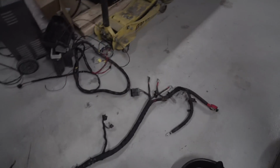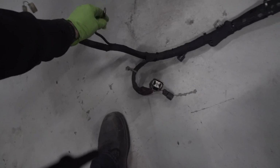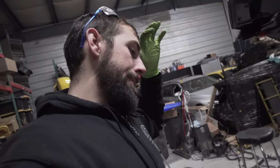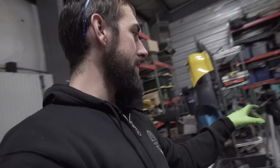So this is the whole charge harness slash electronic power steering harness. Goes to the starter, a ground to the engine, and some of this stuff works like the AC. But basically it's time to throw that in the car so that I can make sure that the coolant hoses and all that stuff don't affect it. And then just keep buttoning stuff up and keep finalizing it. So the goal before the end of the night is I want to get that harness in here. I want to hop in the car, push the clutch pedal, and actually start the car with the new fuel system. I'll have to load a different tune on the ECU, or basically just scale the injectors on the ECU master. But that is the goal for tonight, to actually start it with the new fuel system.